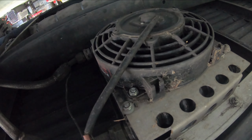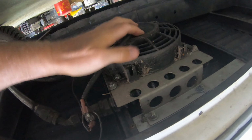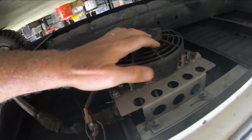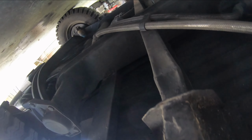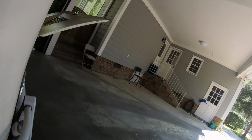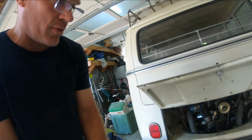So the engine oil is staying very cool, which is the whole purpose. And I know some purists would not like putting an external oil cooler like this. It's also kind of odd to route my oil like 6 feet up from the back of the bus into there and back, but it does the trick, and the oil in this stays very, very cool.